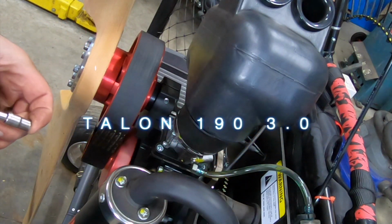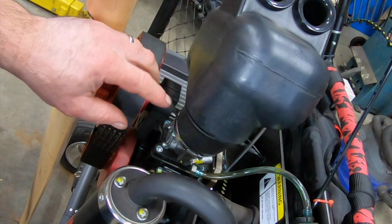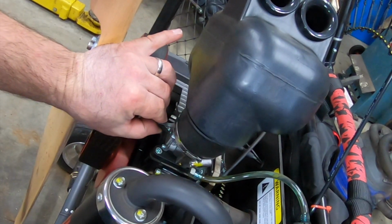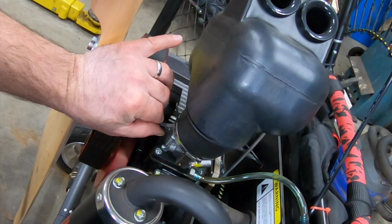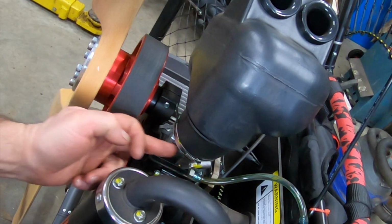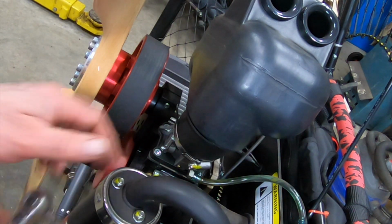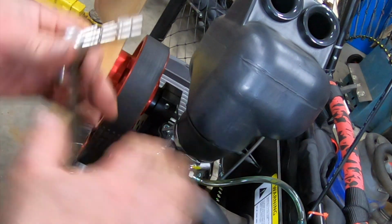It's about 26.5 horsepower, roughly. And if you guys are wondering what this little zip tie is, this is how we prime it. It's kind of a primitive way of doing it, but you stick the end of that zip tie in the little hole there, and just the tension of it being in here is putting pressure on that. It's holding the needle valve open. So when you prime it, give it a couple squeezes, all that fuel squirts straight in there. Then you pull it out and you're ready to fire it up and run. There's no choke on this thing.